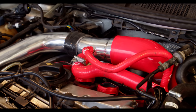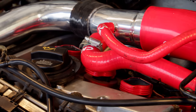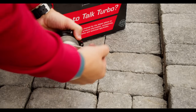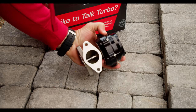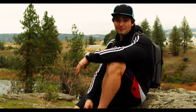Where'd we leave off? We mocked up a number of systems last week, but we didn't cover everything. It really starts with the final piece of the puzzle we haven't talked about yet — the wastegate. A wastegate is a valve that controls the flow of exhaust gas for the turbo. In my case, it's an external wastegate — effectively a little piston. Pressure builds up on one side until it's strong enough to open the flap and release to the other. That's how it controls boost.